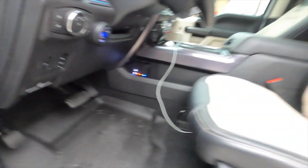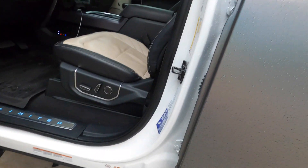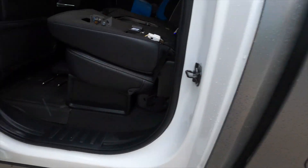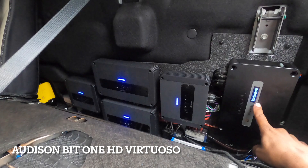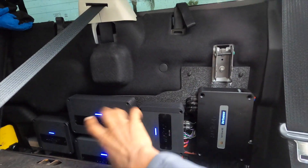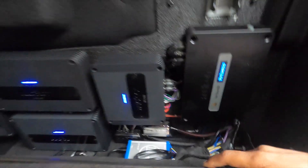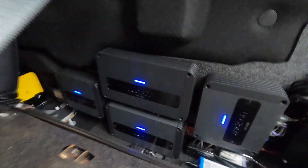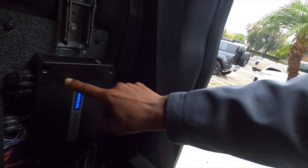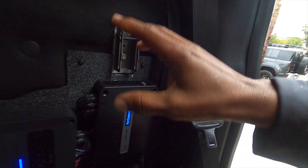I'll go with the white. Audio-wise, we did four Audison amplifiers in this vehicle and the bit one Virtuoso. We made this custom panel here to fit all the amps. We went with the nav TV Zen piece, which takes the factory audio system signal and converts it — it's already digital — and allows us to run optical into the Virtuoso. So the Virtuoso itself is running the audio package in this truck.